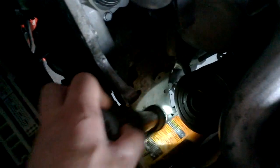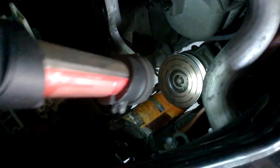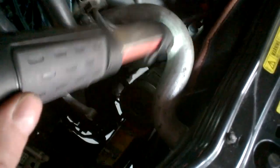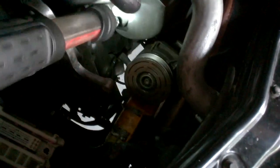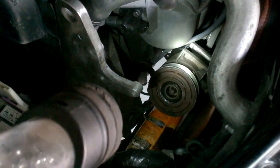There's another bolt for the alternator somewhere there, so you need to remove all three to get the alternator out, and loosen those two as well. These two are pretty stuck with rust — not exactly easy to remove. The best thing is to remove the upper radiator hose. I actually managed to pass the alternator through the hole without removing any hose but it's definitely tight.